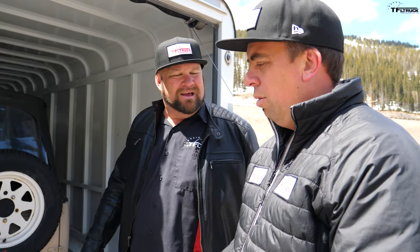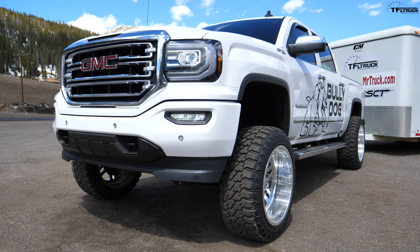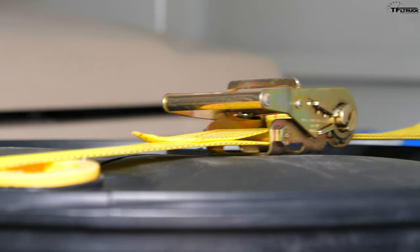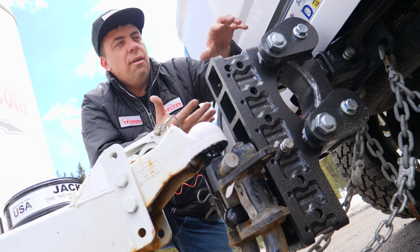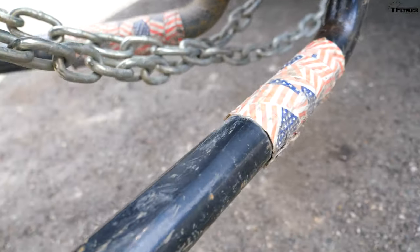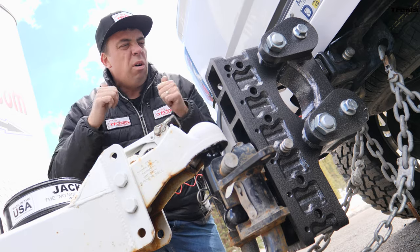Do you know why? Well, because I'm very careful with weight — we don't want to cross any limits here. When you modify your truck, you can't expect the same ratings the factory gave you from the beginning. You have to be very careful. In this case, we're towing about 8,200 pounds, and I got the weight set up right with about 820 pounds on the tongue, and we're using a weight distribution hitch. When you have a lift on your truck, you've got to have a drop on your hitch, and we're using a Gen Y Torsion hitch to smooth out the ride, along with a weight distribution attachment — bars that lift up the truck a little bit and distribute the weight.